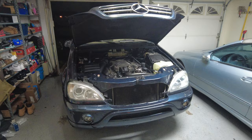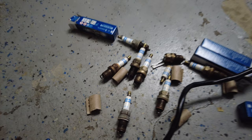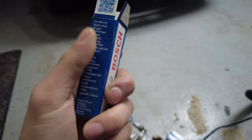Right now we are working on the spark plugs on the ML500. I've only done the driver's side right now and I'm going to do the passenger's side tomorrow — it's getting kind of late. Let me show you what the ones on the driver's side looked like. Definitely had been a long time since they had been replaced. That broken one I accidentally dropped, so it didn't come out of the car broken. Luckily they are the Bosch Platinum spark plugs — the correct spark plugs — but they definitely needed to be replaced. I did replace them with the Bosch double platinum spark plugs off of FCP Euro; these are the correct spark plugs for the M113 engine.